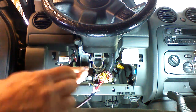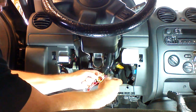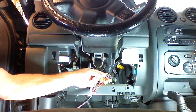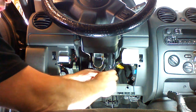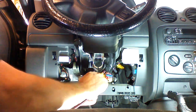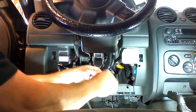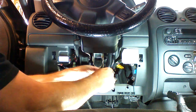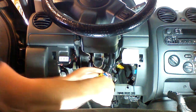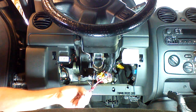Maybe something like the parking lights or something we would use this on, which is this wire. So if we decided to use the Posi tap again, same principle. Put the tap around the wire, screw down, and a smaller parking light connection will be accepted in the collar. Simply push it in, screw it in, and it locks down. And there we would have our parking light connection.